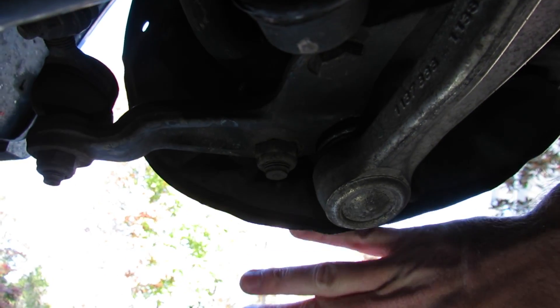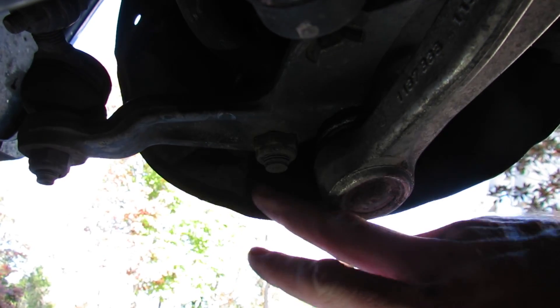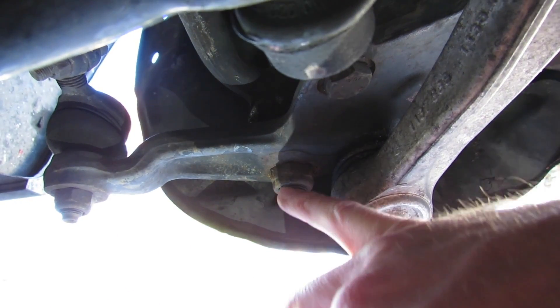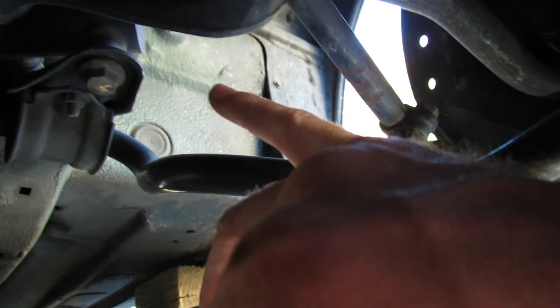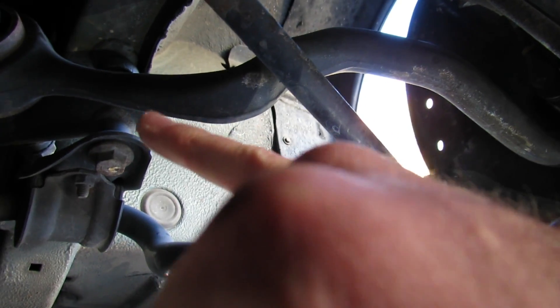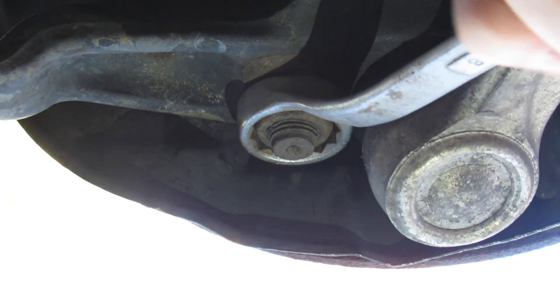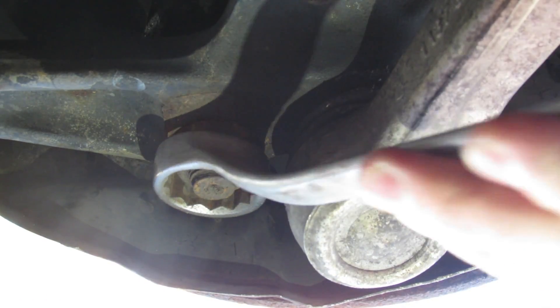We are under the car looking at the back of our brake rotor. The back of the car is that way, the front is this way. This is the nut that holds the ball joint for our thrust arm. We're going to remove this nut and pop the ball joint out first before finagling anything up in there. Go ahead and get our 22mm wrench on here — you can also use your socket and breaker bar, but this one seems willing to work with us.